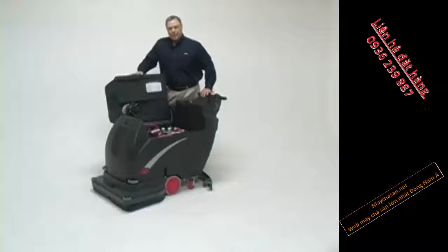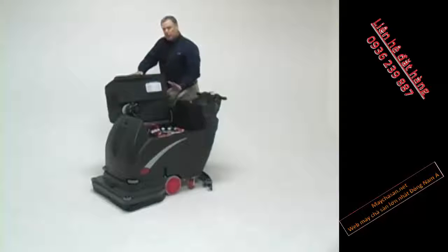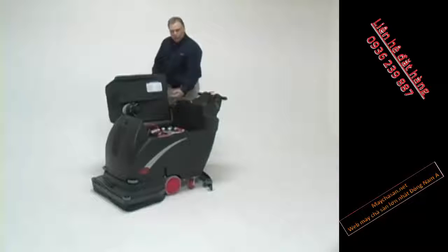The three-stage vac motor is attached directly to the bottom of the tank as opposed to using hoses — no bends, no wands, no loss of airflow as a result. If you'll notice here, the tank slopes to its lowest point at the junction with the solution drain hose, so the ability to drain the tank and keep it clean and hygienic is improved.